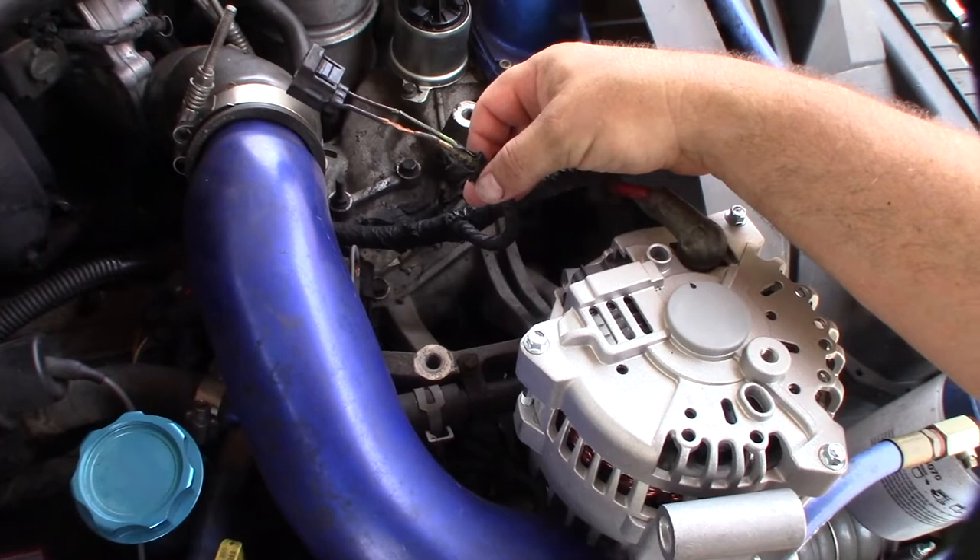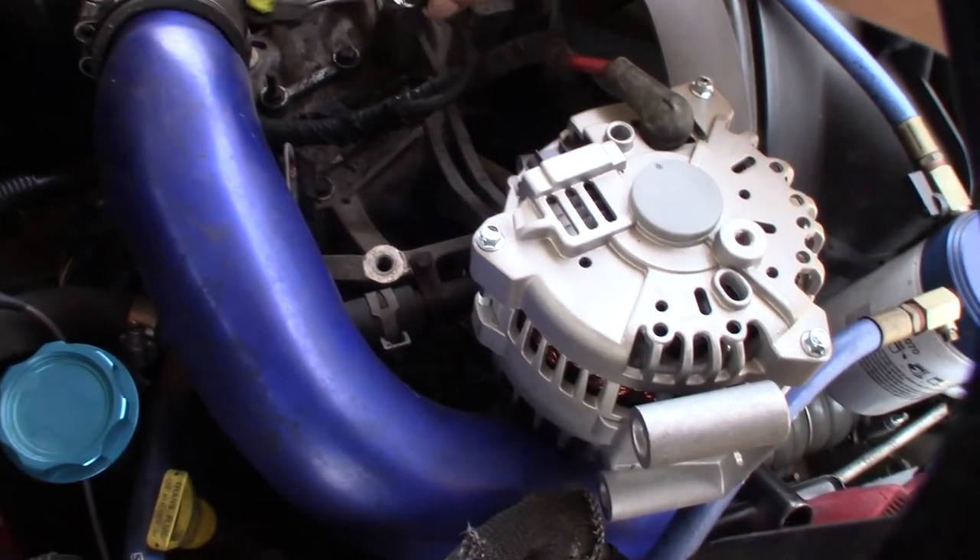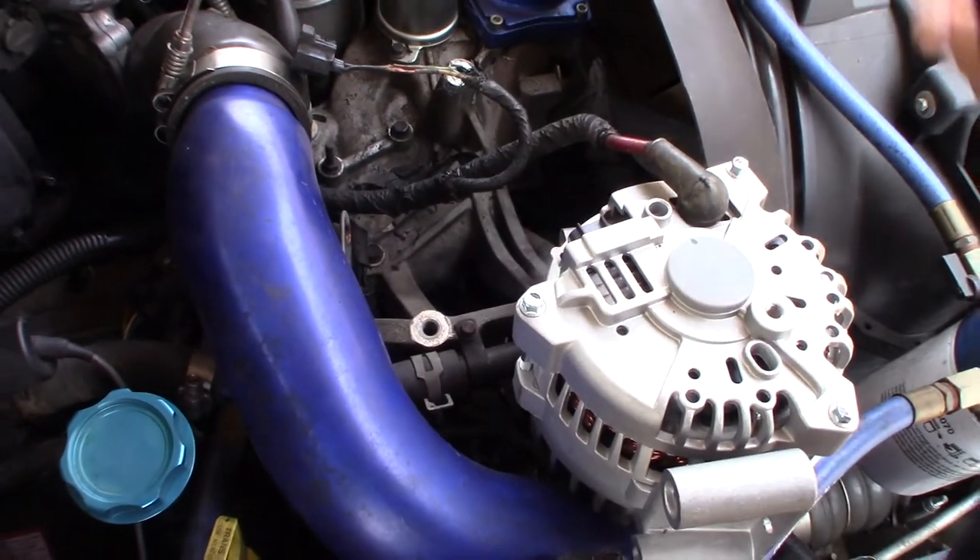So if you're having a charging issue, make sure you check these wires that go to the feed right here. I'm going to pop them off, probably put some shrink wrap on there.